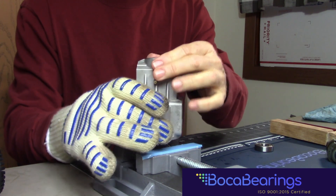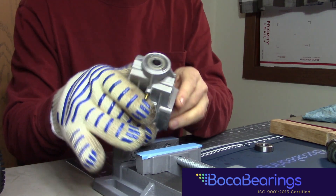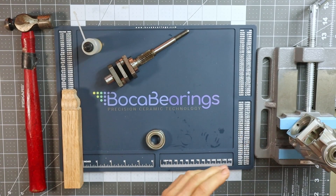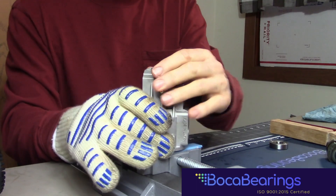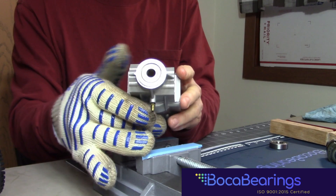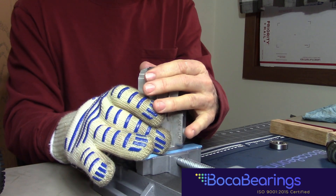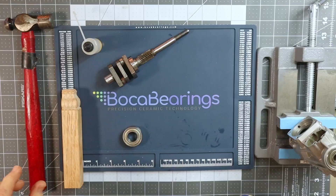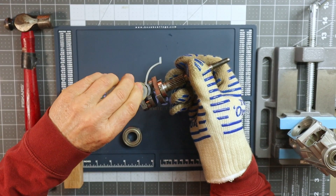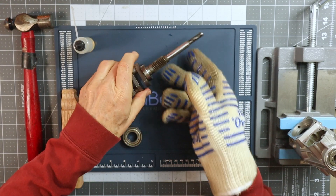It's not even all that warm because this is a large crankcase. And as you can see, that bearing is installed completely right now. Since it seemed like there's a lot of mass in this crankcase, it didn't really heat up as much as I thought it was going to. So what I'm going to do next is put a little bit of lubrication on the outside of this mid bearing, because that's the one we're going to install next.